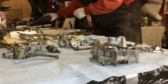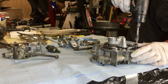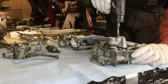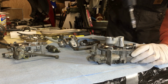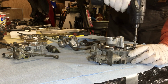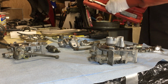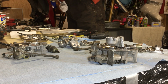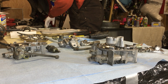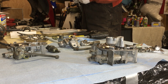So, it says 35 inch-pounds. So we're going to go down with the gun here. Kind of evenly. And, okay, whoop. There we go. Kind of go to the cordless clutch there, see where that is. And I did leave this at Dad's. Here's my Snap-on inch-pound. So I'm going to have to break it down like this, and then break it down like that. It says here 35 inch-pounds.